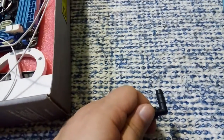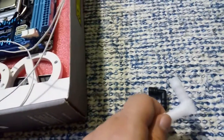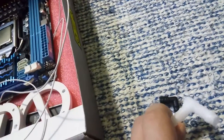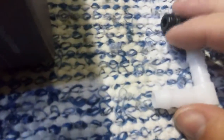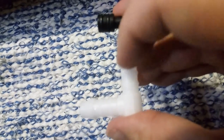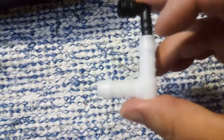So I need to modify this a bit. Those radiators have barb hoses built in that you can change — there's a six millimeter barb hose on those. Here is a 90-degree angle barb hose adapter with about eight millimeters inner diameter and ten millimeters outer. My plan is to heat this white adapter and push the six millimeter barb inside it so it becomes a 90-degree bend, then put a hose there to fix the tube-clearance problem.